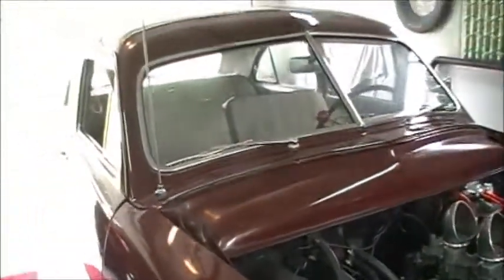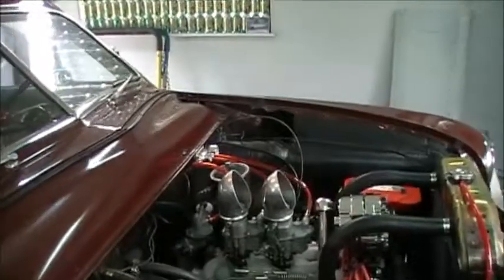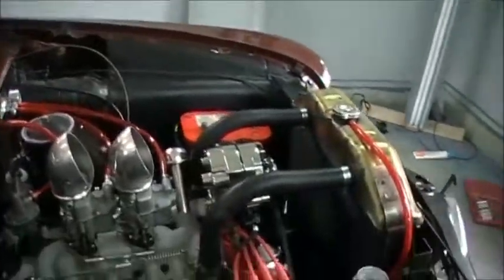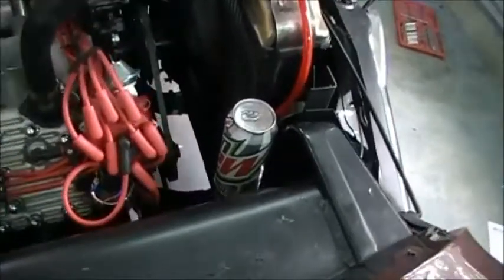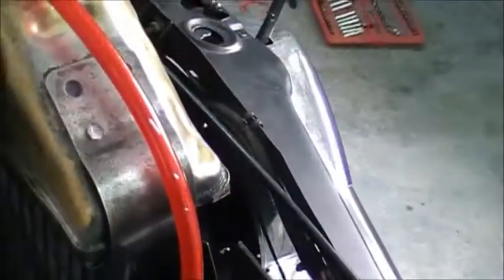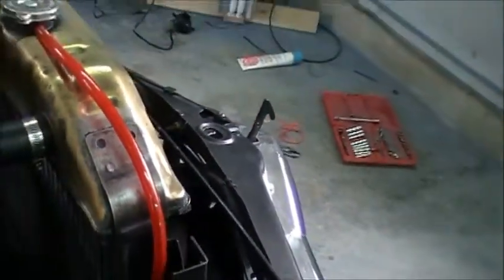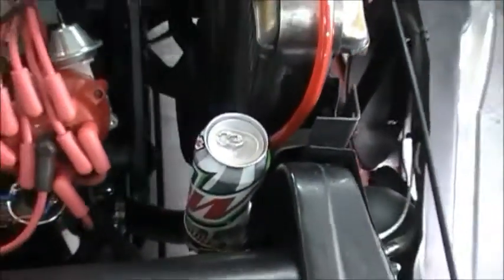The old Ford's doing pretty good. Drove it to work on Monday because that's the only day this week it didn't rain. Got the overdrive working and it goes down the freeway pretty good. Got a little overflow can set up because coolant was dribbling out of that hose, hitting the windshield — the fan would spray it up — so I got that sorted.